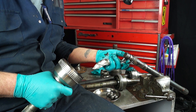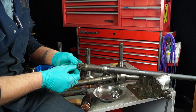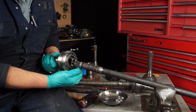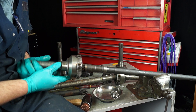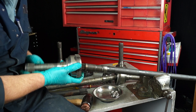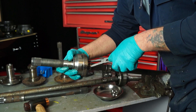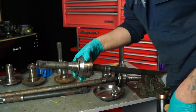Don't forget to put the collar on — that's really important. Then put the CV joint into place. I've got the clip here, and that's easy to put on. You should always really replace them. If you're going to fit the CV joint and you just whack it on like that, you might well have a problem because this needs to be squeezed up a bit. So I'll get a pair of pliers here, squeeze it up, then knock it on. It's using a pair of long needle nose pliers and then just tapping it into place, so it'll go easily.